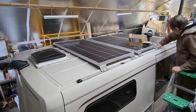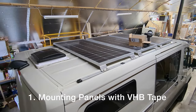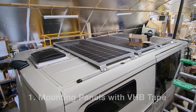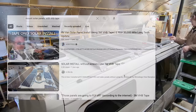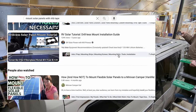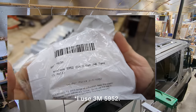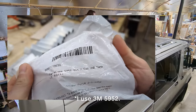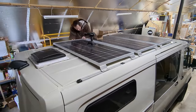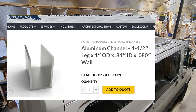I've got a few quick things to mention upfront while I play this footage of me removing the old panels. First, I'm using VHB tape to mount some aluminum brackets to the roof that I'll then bolt the panels to. This is a fairly common practice in vans and I've never had any issues with it, but you need to be pretty careful. Make sure you've purchased genuine name-brand VHB tape, ensure everything is as clean as possible for good adhesion, and I specifically chose aluminum extrusion with plenty of surface area to get good strength out of that VHB tape.